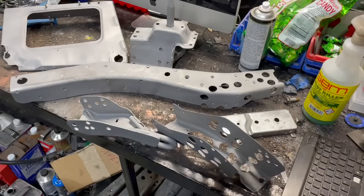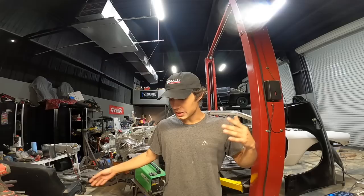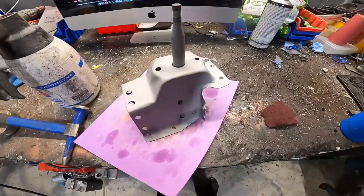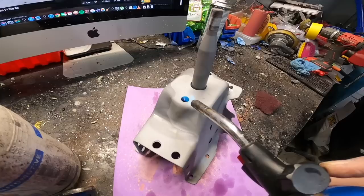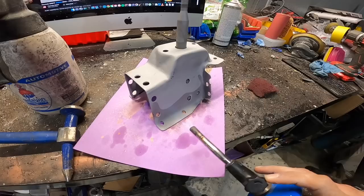Look at how well this turned out — my subframe stud, absolutely beautiful. And the most impressive piece: this was just completely rusted out — you guys remember this is the inner frame rail structure beam. Absolutely awesome, brand new. Before applying my rust spray, I like to hit the metal with a torch first because you can see all the moisture already built up in the metal — you can just see it evaporating away. Once that's done, I'm happy to put the spray on.